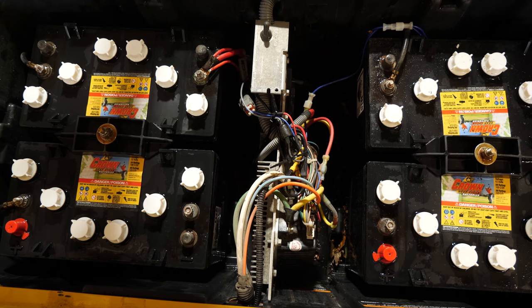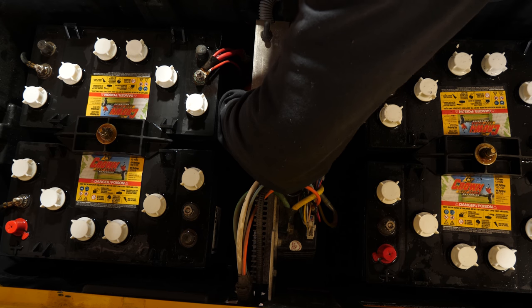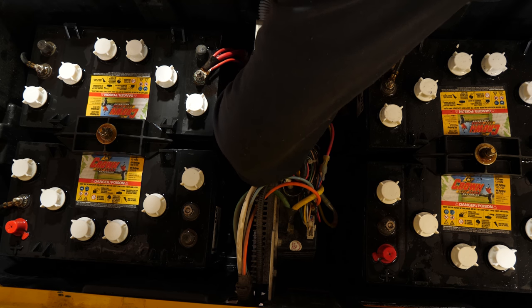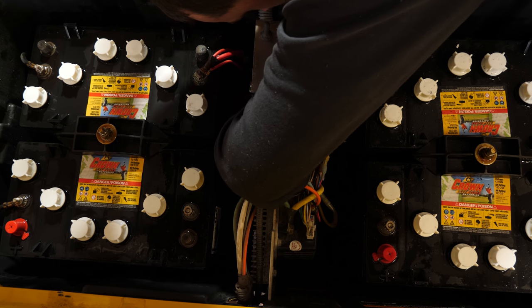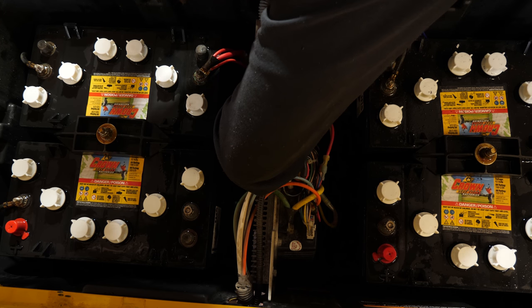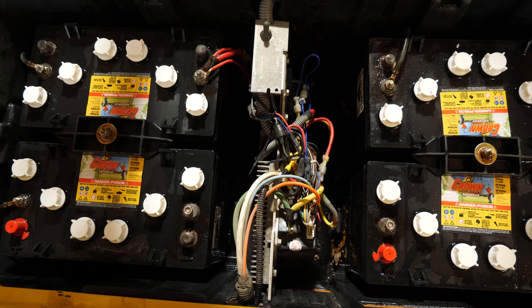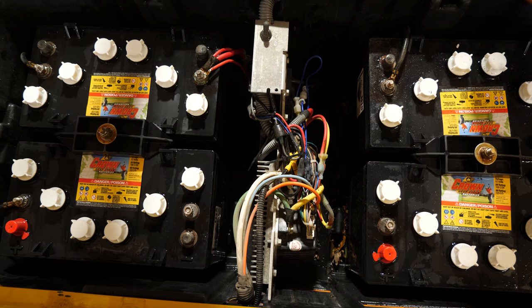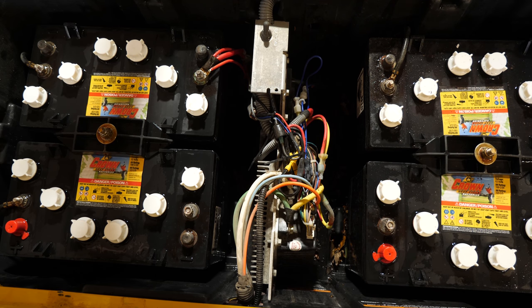What that basically does is it disables the onboard computer from doing any charging. The onboard computer does nothing now — it's just part of the golf cart. You can remove it if you want but it's not really necessary. The only issue is you can no longer use your Club Car charger; you have to use an aftermarket charger that is capable of working with a cart that does not have the onboard computer, and that also has a 48-volt connection like this cart does for charging.